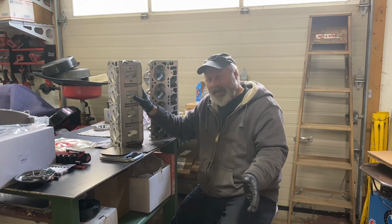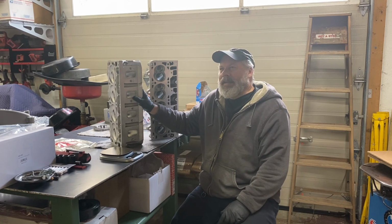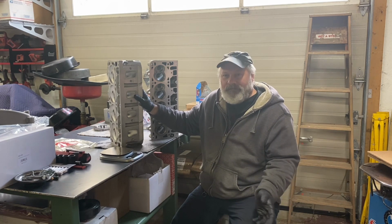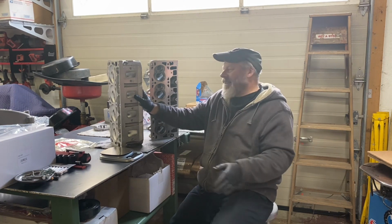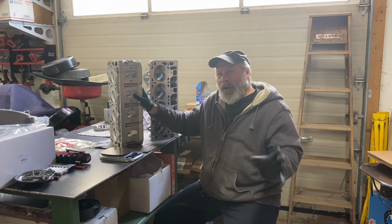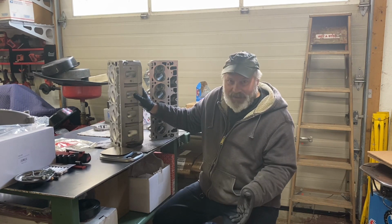Now he's into his build, and he wants to get a different head from the same supplier, 3V Performance down in North Carolina. Tom Vigu, great guy. He's going to buy heads from Tom, along with a rotating assembly. I bought these heads just the other day already. There's some pros and cons. Again, I'm hoping I can make the combustion chamber work without having to buy a different set of pistons, because that's where this whole thing started. Low bucking my motor together, I found a really inexpensive set of Mahle forged pistons. That remains to be seen.